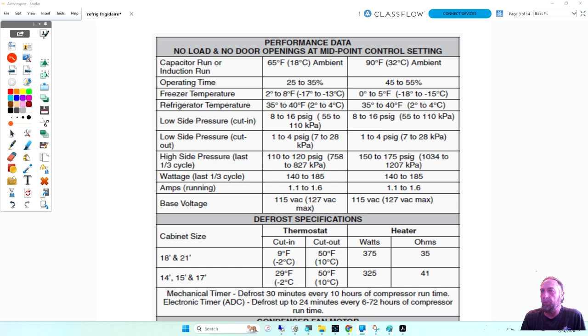Well, if the condenser's cooler, remember, refrigerators work off of temperature and pressure. It'd almost be like you're low on Freon if your condenser pressure or temperature is too low. So your evaporator would not completely freeze, and that was what was happening with this ice machine. It acted like you were low on Freon or had a partial restriction or something, because you weren't getting enough pressure into the evaporator. So your condenser and your evaporator pressures and temperatures are very important, that they are each what they're supposed to be.